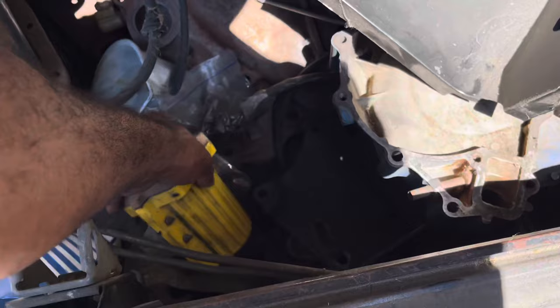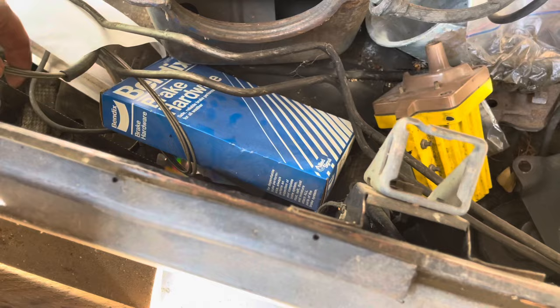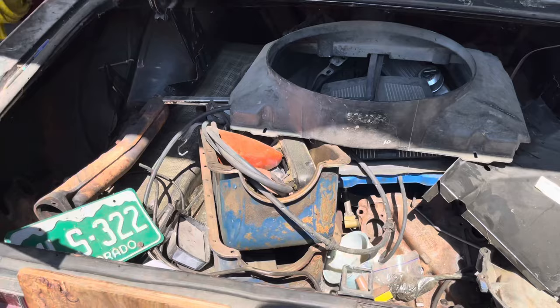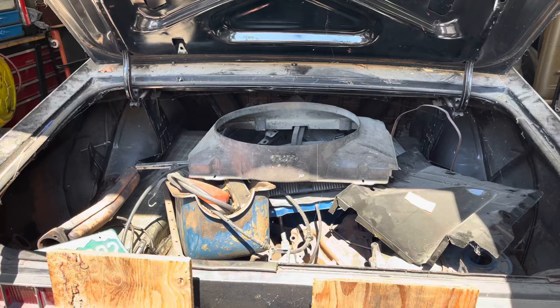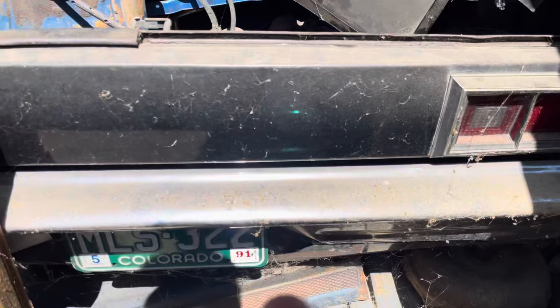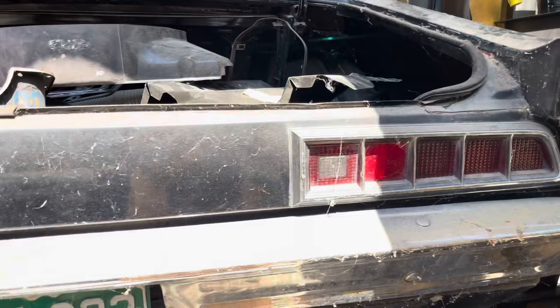I have a Cleveland block port that's all been done up — some old NASCAR C3 aluminum heads. I got it from a guy in Oregon; it only had dyno time — he was doing R&D for the truck series. I have an intake and everything's ported and polished, and a set of stainless steel headers. That was the plan when I was making a race car out of it. Those Clevelands have gotten really popular in the Fox body. This whole car was probably repainted — I don't even see any residue of the Cobra sticker.